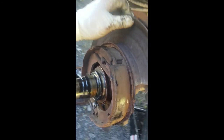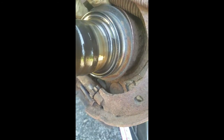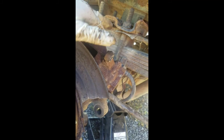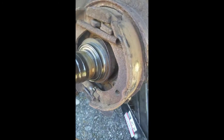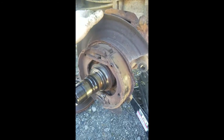Moving on, you've got four bolts in the back — I can't remember exactly what size, maybe five-eighths or eleven-sixteenths. Loosen those and that's going to let this whole backing plate come loose so you can pull it off the axle. Once you have your shoes completely off, you can see the back of those bolts there. They're not a hex head — they are splined, just like a lug nut on a wheel. Once you loosen those and have this piece on the ground, the emergency brake cable is going to come with it. Make sure to secure the caliper. Once it's off, you can actually drive these bolts out with a hammer — give them a few good whacks with a ball peen and they'll fall out, and then you'll be able to pull the rest of this backing plate off. The backing plate will actually come off of this metal piece — you can see it's two pieces.